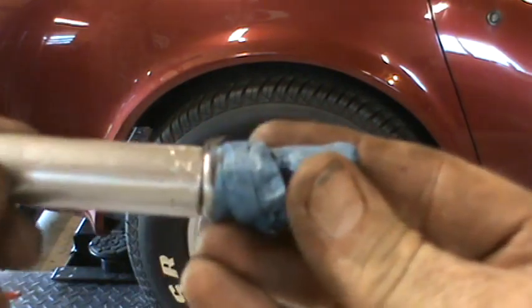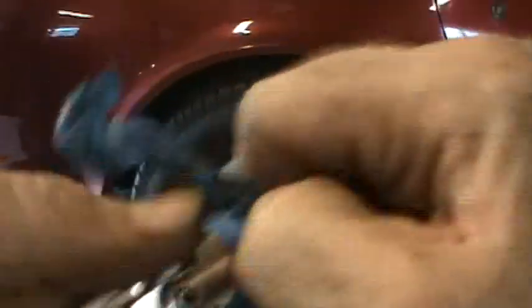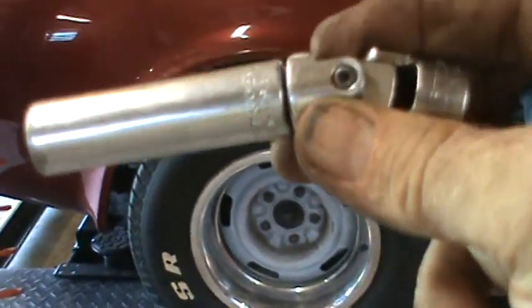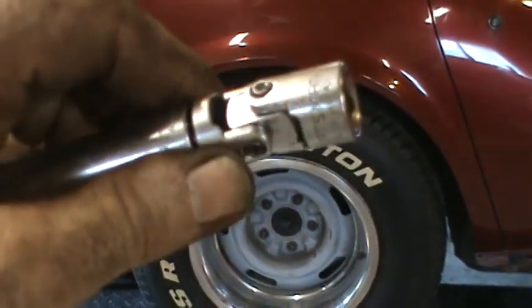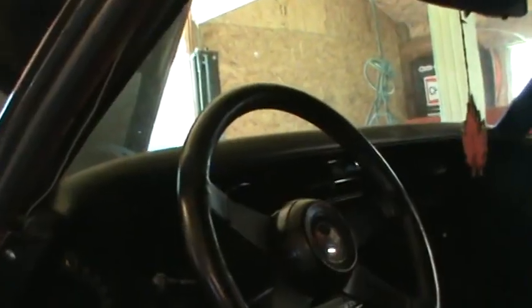Here's a little tip: I had to use a long extension and a universal joint to get up and under there. A lot of times universal joints are kind of floppy, so what I did was wrap it in tape to give it some rigidity. Without the tape it just flops down and it's hard to keep it on the bolt, but with tape it stays more rigid. Black electrical tape is best because it stretches a little and is sturdy — it doesn't rip like masking tape.